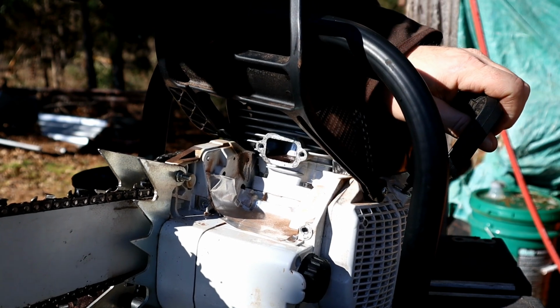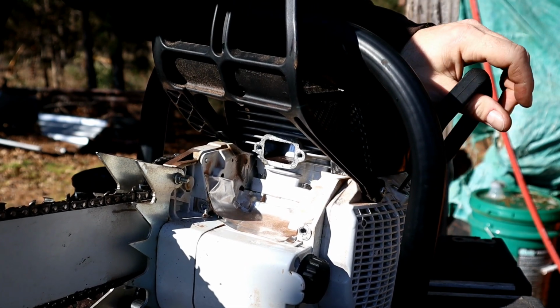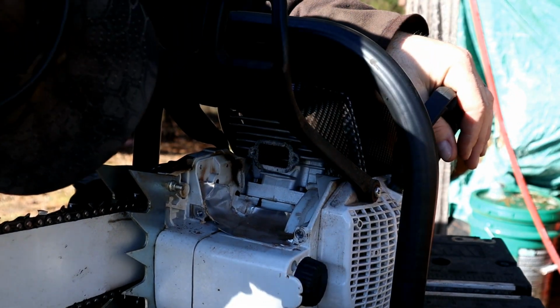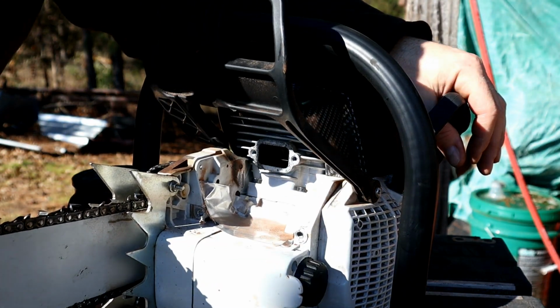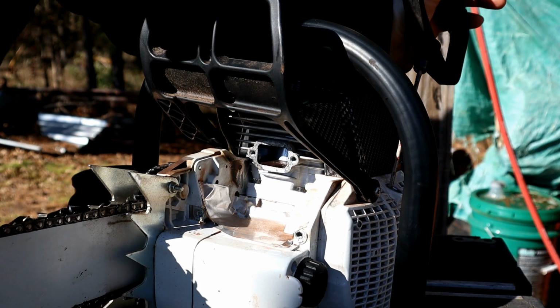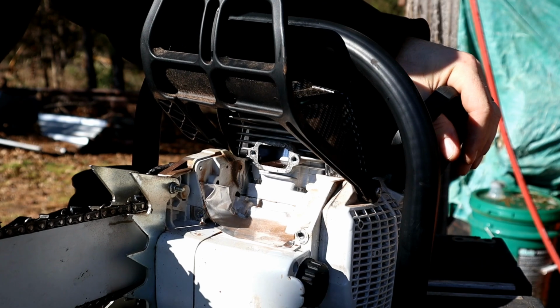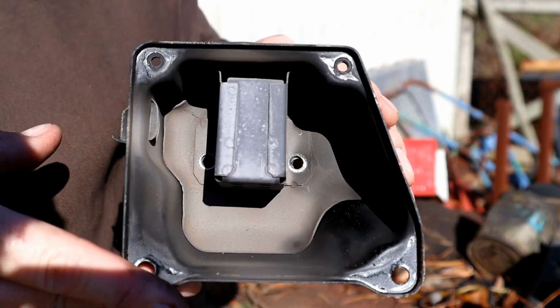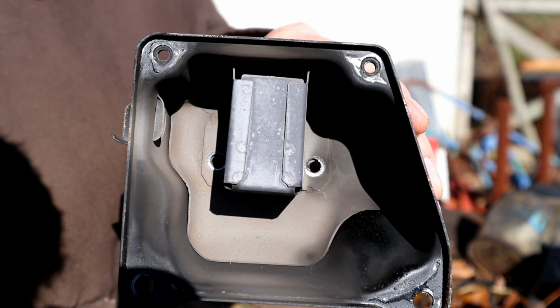And you can see there the piston. It actually has a little bit of red armor on it there, but man, that red armor runs clean, clean, clean. You can actually see a little bit of the red on that exhaust port, but the piston, everything, I mean, there's like zero carbon in there. Just beautiful.